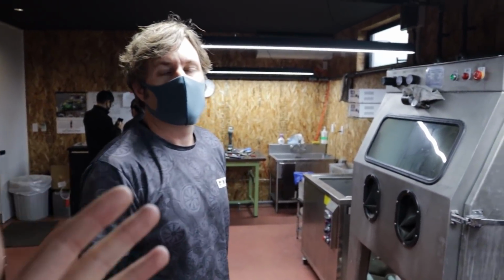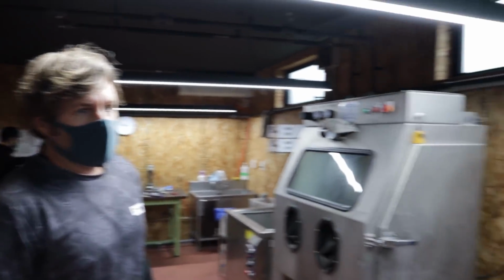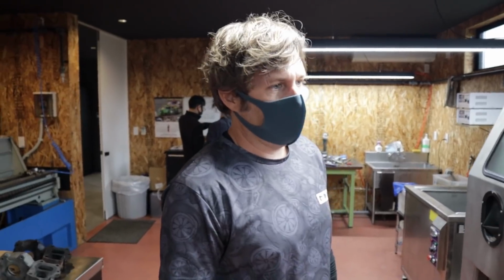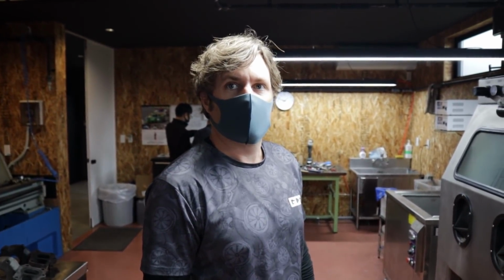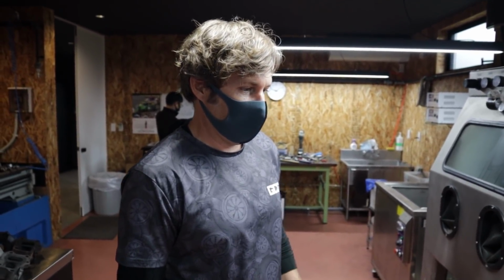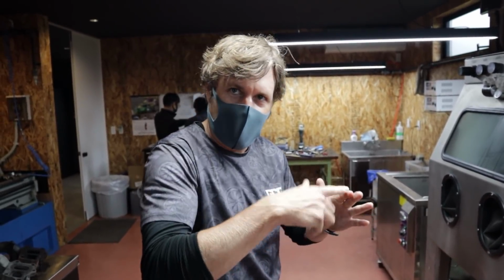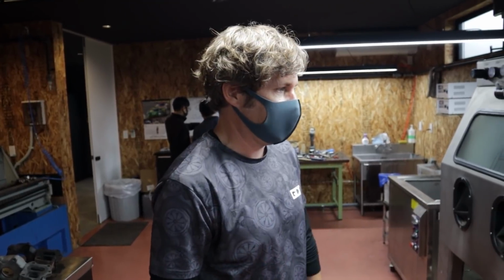So what would happen if you were balancing a turbo and a fragment of sand or even any bit of dirt got in there? It can cause major damage, because once it's spinning at that speed, even a little bit of grit, you start grinding and wreck the bearings.